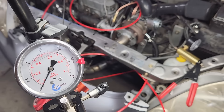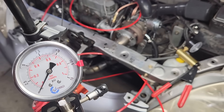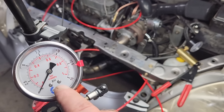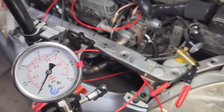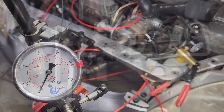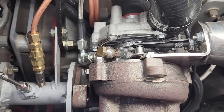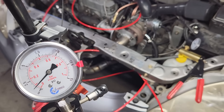Let's start this beast and see what kind of back pressure we're dealing with. At this point, there's no vacuum on the VNT accumulator, and there really shouldn't be any back pressure in the exhaust system. So at idle, there's zero back pressure in the exhaust system. Let's see what happens when I goose the engine. That's excellent — there's actually zero back pressure in the entire exhaust system. And that makes sense, because the exhaust system is way oversized for this engine, and this car doesn't have a muffler. Let's apply full vacuum to the accumulator, and that'll move the nozzles into position where the turbo is now trying to make boost. But since there's no load on the engine, it won't actually make boost. However, we should see some back pressure.